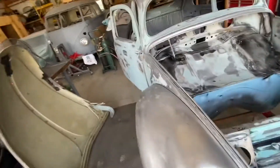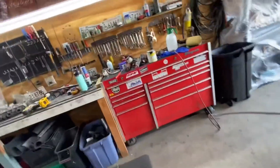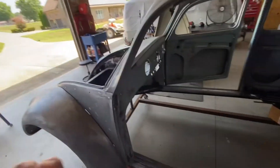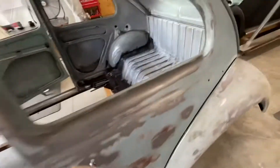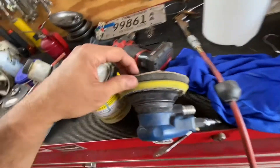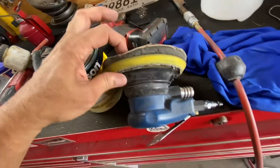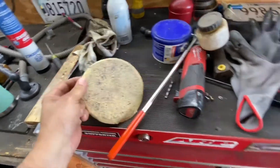Alright, let's stop talking and get to it. I've been hard at work - I did all the sanding and I used my DA sander with a soft pad. Let me show you what I use, because now we're hitting contours - those ripples are really hard with a hard pad. So I got this soft one and I got this one that is harder. The harder one I use for flat surfaces, but for those contours I use the soft one.